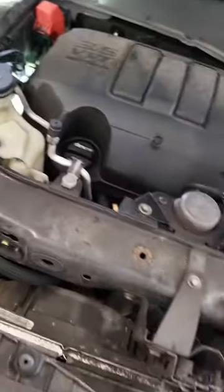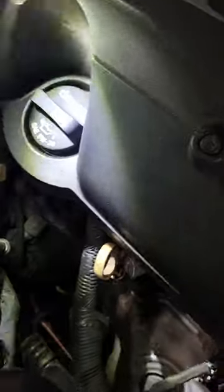Let's see if I can point to it. I'm going to point to it with my seal pick right there. See that crack right there — that's the upper torque mount. So that tells me the front motor mount here is definitely worn. Typically what I see on these is the side transmission mount, the front engine mount, and the torque mount are all wiped out.